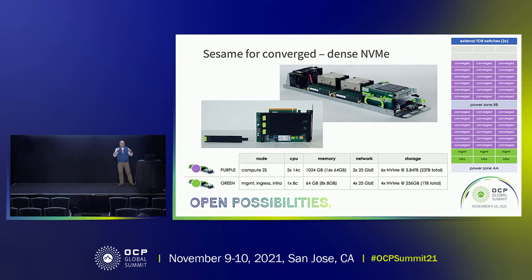What we did with our servers is we used this OCP design. The card shown there is called an Ava card — it holds four M.2 NVMe devices. On the Leopard server shown here, we have an x16 slot and an x8 slot, meaning we can take six total NVMe M.2 devices up to 3.84 terabyte and plug them directly into PCI off the riser — no controller, no level of indirection, no performance speed bump. This card is basically just plastic and some traces to get it connected. We've really leveraged the OCP model: simplified and high performance.